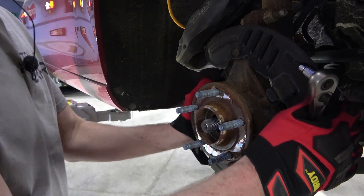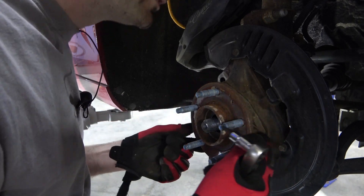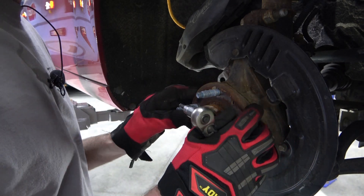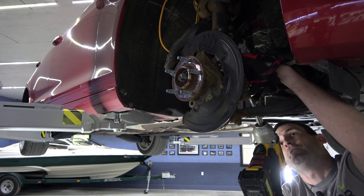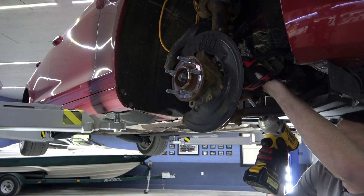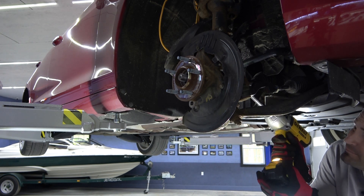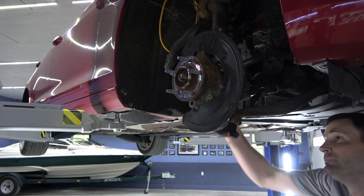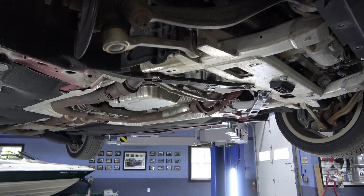Now I'm going to get you the best view of this as I can. Behind here we should have three pretty decent beefy bolts that hold the hub itself on. My microphone cut out at this point so don't try to line up my lips with this voiceover. We're just getting the bolts off the back of the hub. The toughest one to get to is the most forward one — I used a combination of an extension and a swivel on the end; still a pain but definitely doable. I dropped the plastic shield that hides a lot of this stuff.